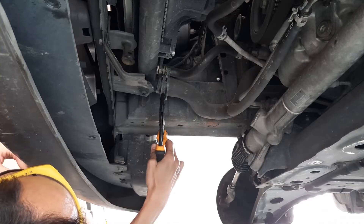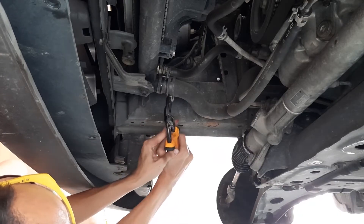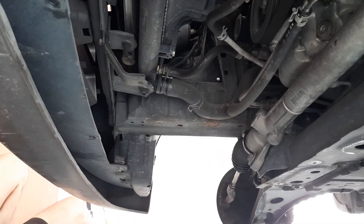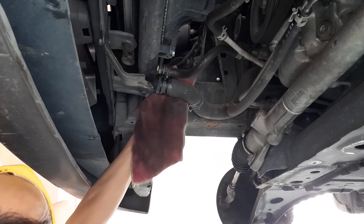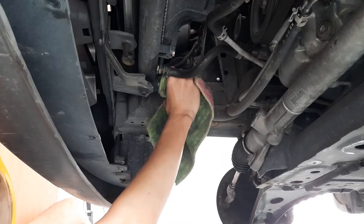I'm using a pair of pliers to loosen this hose clamp — just press the hose clamp in together, which will loosen it, and then slide it off to one side. With the hose clamp removed you can now remove the hose by just pulling it. Make sure you've got a bucket or a pail prepared because the coolant is going to come gushing out.